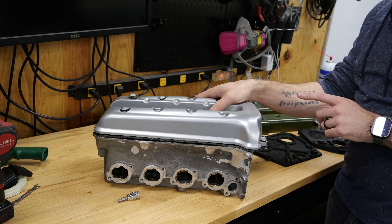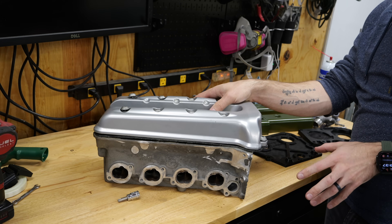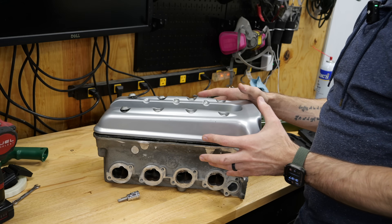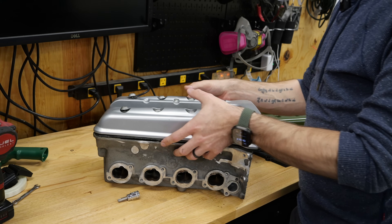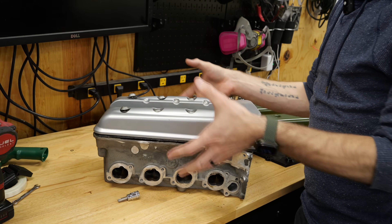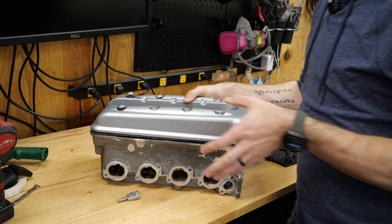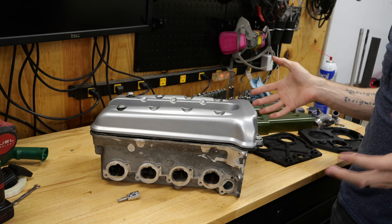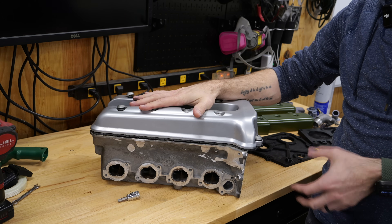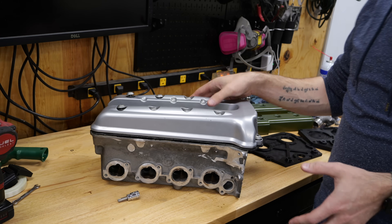One interesting thing about these cylinder heads is that they are very, very close to being bolt-on to an A-series block — in terms of dimensions they're almost the same size. What's crazy is that this cylinder head, even with both cams in it and a much larger footprint, easily weighs half what the five-port steel head does, which is really cool by itself. But there are a number of supporting mods that you have to do in order to put this on an A-series block, and we'll get into those as we get into this project.